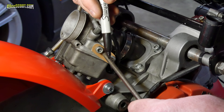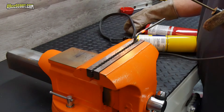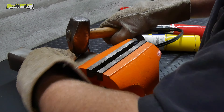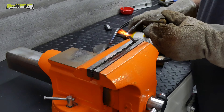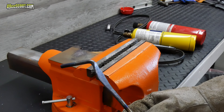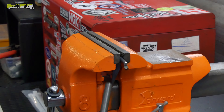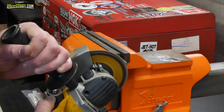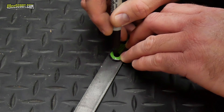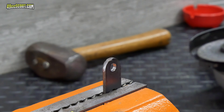At this point I could thread bolts into the carb, so I started making a bracket, beginning with a template for a mounting plate. I marked a piece of quarter-inch steel rod where I wanted it to bend so I'd be able to use the mudguard mounting bolt as the support, then bent the rod in a vise. I used a technique I'd recently watched a forum member called Rolling Bender use — I heated the end of the rod with an oxygen and map gas torch, and once it was red-hot, hammered it to create a flat spot. It took a few rounds, but eventually I had a flat spot to use for mounting. I did some fit checks and cut the end of the rod that needed to attach to the bracket, leaving some rod beyond the flattened spot to use as a handle while trying to get the two pieces welded together.